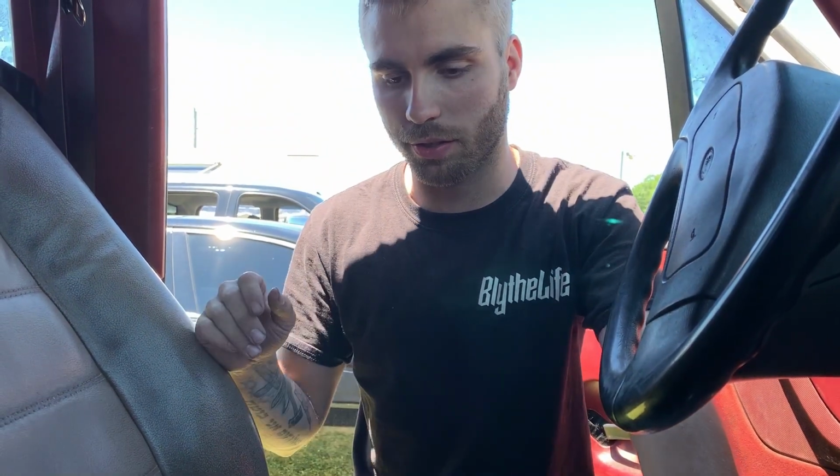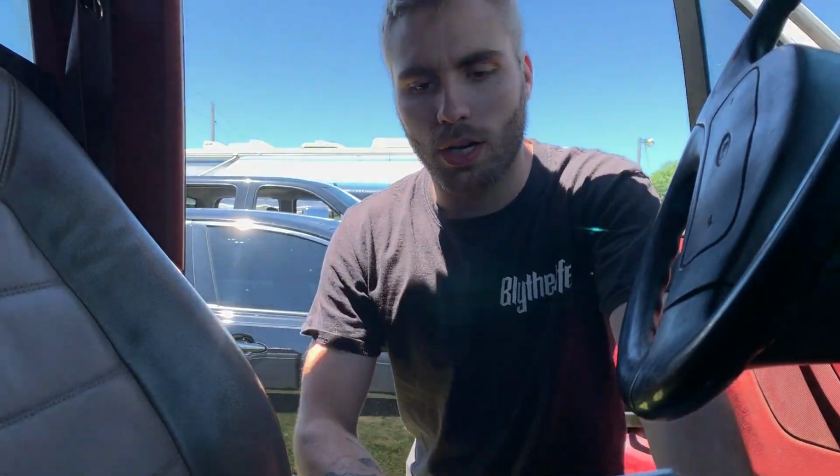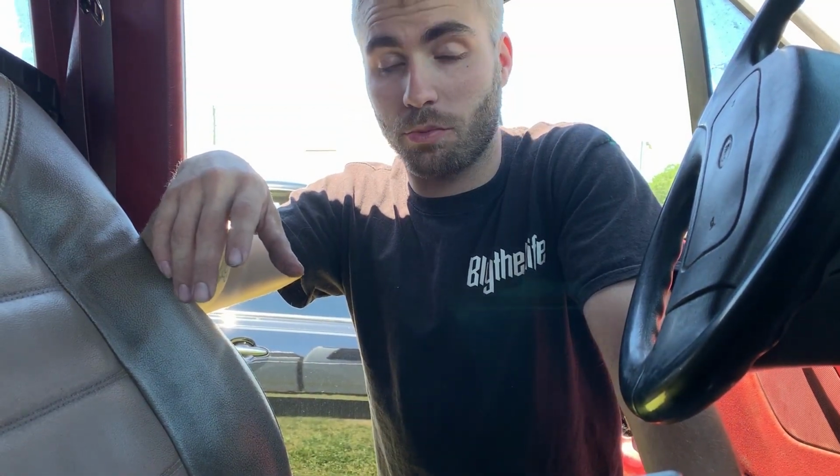So the ultimate story for that is I need another blow-off valve on the other side so we can get all that pressure out of there quicker for recovery situations. Normally I wouldn't be doing that at all. I'd be staying full throttle the whole time, so you would never have that problem, except for maybe at the very end where you let off for a split second. You know, you got that high ramp of boost before it blows off the blow-off valve. But what was it? It was a 1.5 60 foot, which it would have been a lot better than that, but I mean, I instantly let off just because it scared me and I'm a pussy. Whatever.